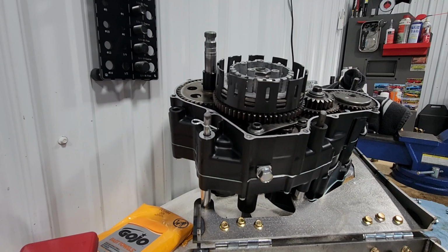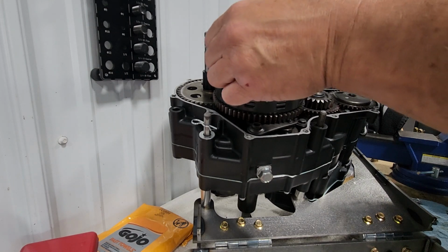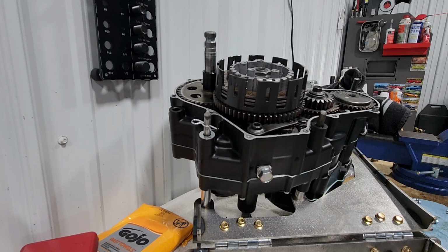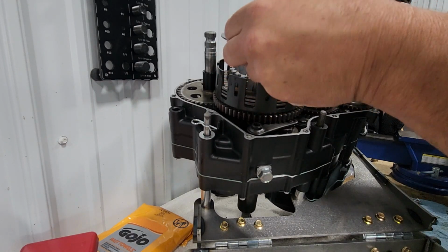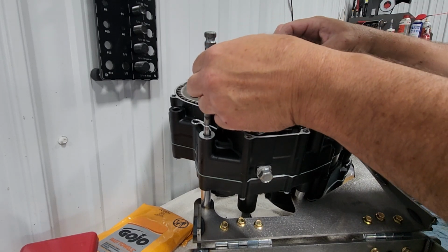Now, to get to the middle of the pack, from what I've seen and most things that I've read, I'm going to put the thicker steel plate as my third steel plate. I've seen most people putting it as the third or fourth steel plate. Unfortunately, with the way it lays out, there really is no middle. So you're kind of one position or the other. So we're going to put the thicker one in now. Same thing, I'm putting the rounded side facing up.